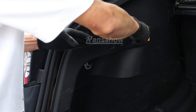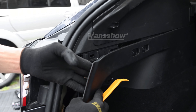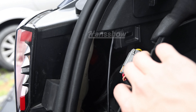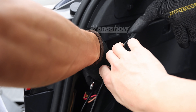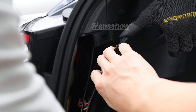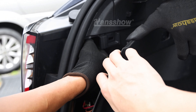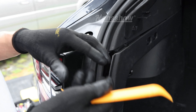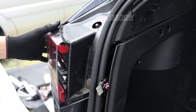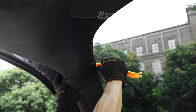Now move to the left hand side and pry open the plastic trim again. You don't have to remove this completely. There is a 12-volt outlet here — you can unplug that if you can't get your hands behind the tail light. There are 3 nuts back here: 2 on the inner and 1 on the outer. Use the socket or wrench to remove them, then use your fingers to finish removing so you don't drop them inside the vehicle. Then pop up the trim on top and pry starting from the left hand side — be careful not to crack the corner edges.